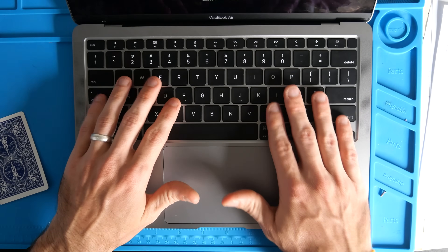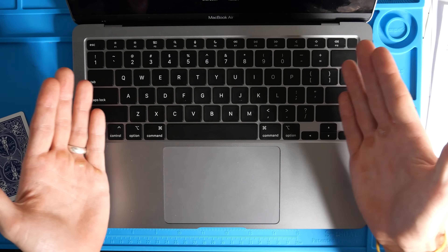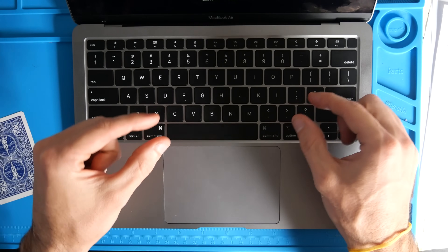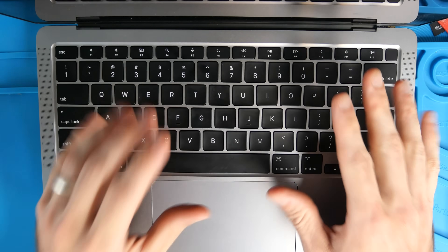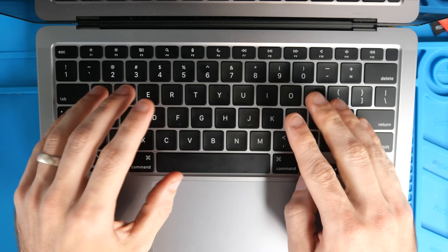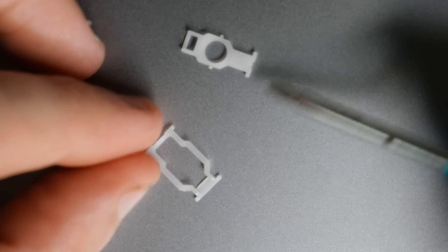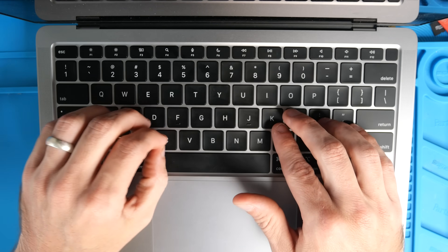There are about five different keys on this keyboard that we're going to remove a little bit differently, so it is very important that you watch this video all the way through so you don't make a mistake and break a little nub, tab, or switch. Tip one: only remove the key caps — do not remove the underlying scissor switch. You can break more things doing that, mangle up aluminum clips, or break your plastic clips.